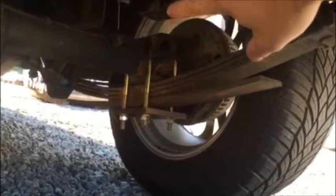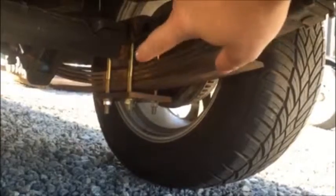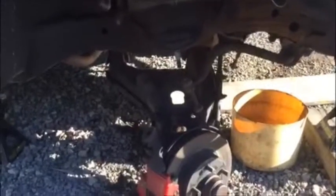I've already dropped the rear. I did my own axle flip kit — only cost me 30 bucks. All I had to buy was the leaf spring seat, which sits between the axle and the leaf spring. I got another one, took the leaf spring off, put it under, slapped that on there, made my own plate, and got new u-bolts because I had to burn the other ones off — they were so rusted. Then I clamped them all together and made sure everything was real tight.